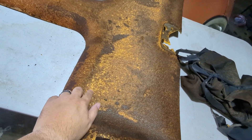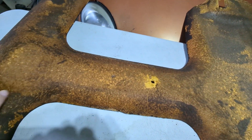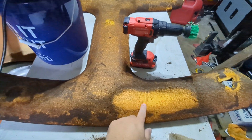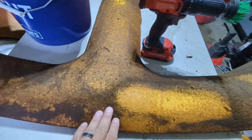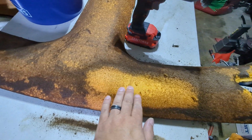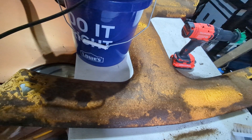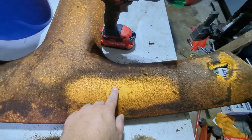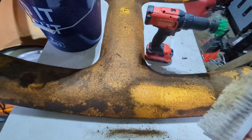Here's what you're left with — a lot of old glue and old foam. Where it's darker you want to get it down to where it's yellow or just clean foam. The next thing we're doing is cleaning up this foam backer board. You want to get all this old glue and foam off so when you put your new material on it has a clean surface to stick to. Like everything with paint and body work — prep, prep, prep is very important here.